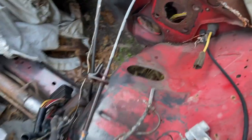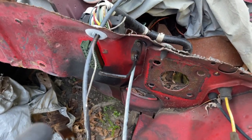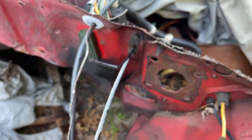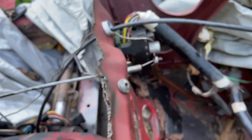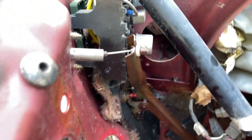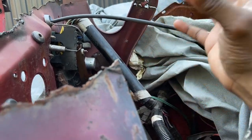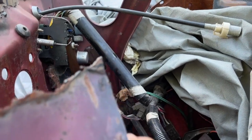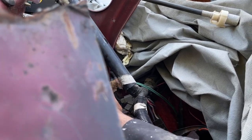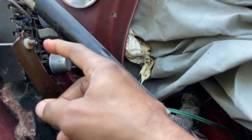This is a cutout, you get a three-dimensional view of everything, how it works, how it functions, how it's installed in this vehicle. There are 3/8-inch bolts — those are the two first. But before we remove those, I think we should focus on this. This is what I mean about it being difficult to remove from underneath the dashboard, because there's a housing here that the steering column sits in, and also there's the brake pedal. So all that's hiding this and it'll be tough to get in under here and get this cable out.